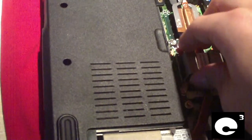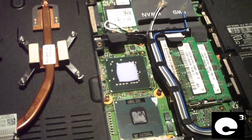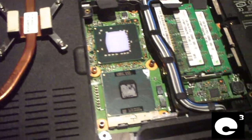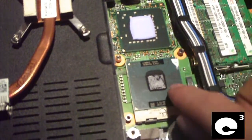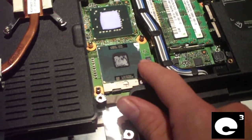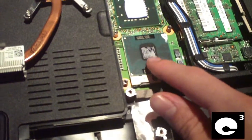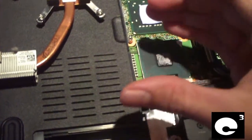I'm going to pull this off so you can actually see the CPU and the Northbridge chip. This is a Pentium Dual Core processor and an Intel Northbridge — not sure exactly what model — but it has integrated graphics with HDMI outputs. This is how the CPU on a laptop looks. It looks different than a modern desktop processor because modern desktop CPUs have heat spreaders, while in the notebook, they never used heat spreaders because the heat off the die goes straight to the heat pipe, whereas in desktops you have a big heat sink that sits on top of the CPU.